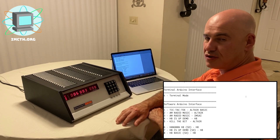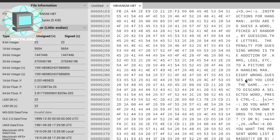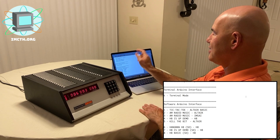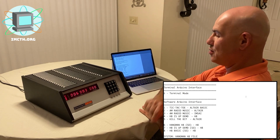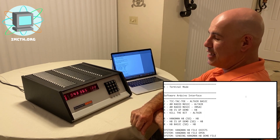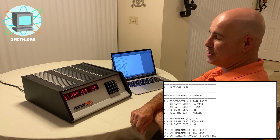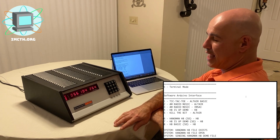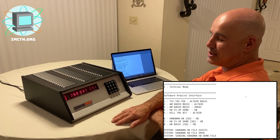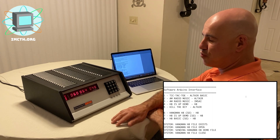The code, which I'll show on the screen, is a small example of what the hex code looks like. I'm going to hit Load again and then hit number 6 for the demo — as soon as I hit it, it starts loading right away. This program is a little bigger, so you can see the address and data coming in on the display. It's uploading at 1200 baud. As soon as it's done uploading, the machine will stop and we'll be able to run Hangman. These are really great machines, and people made additional improvements and connections to them.